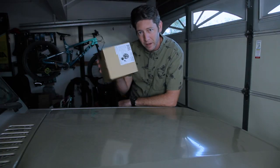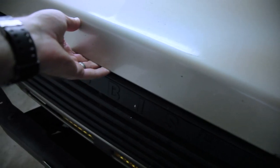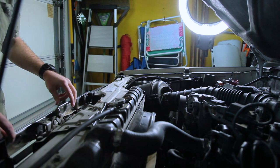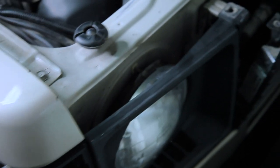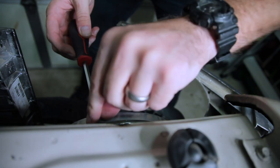I'm not testing this at night, but I can turn off the lights in the garage to make it a bit darker and we'll take a look. The swap is very easy to do. You remove the parking lights, unscrew a few screws, slide the grille forward to get some access, remove the headlight surrounds, and you're in. The metal trim is three screws — that comes out, the old headlight comes out, and the new headlight goes in.